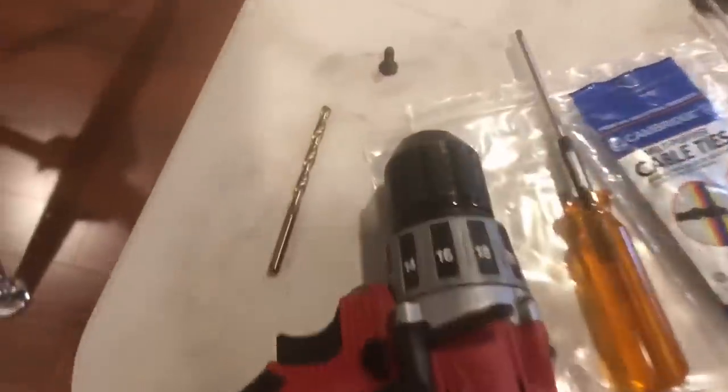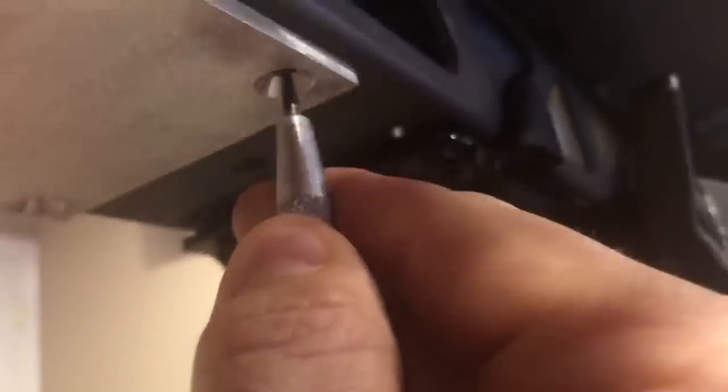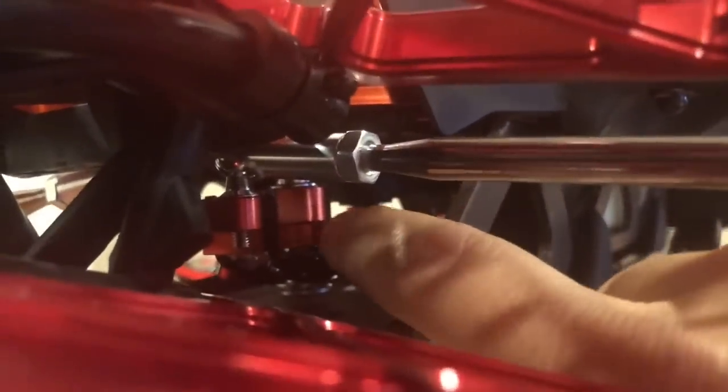Perfect — look at that. It's got to drill these two holes out. I'm just gonna button this up, drill a bit, and a hole punch. Grab yourself a hole punch like this — all you got to do is put pressure and it'll snap. Try to get it centered as best you can and just push up — look, it'll snap. One more time — done. That's where the bit's gonna go. Throw a little 3-in-1 on your drill bit and drill upwards. Do not over-press it because you don't want to mess up your beautiful steering setup aluminum.